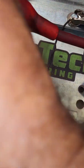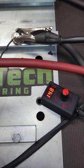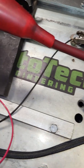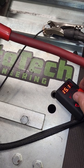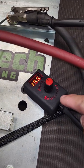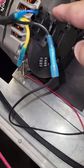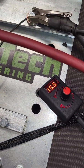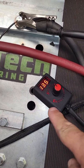Get proper ground and you're back to being able to see the voltmeter displayed. Again, it's a very simple setup of just two wires. The important things are: be careful not to pull the harness and dislodge the pins, and make sure that you actually do have a sense pin on your internal regulator so this will function properly.